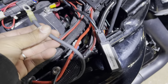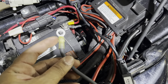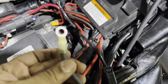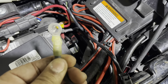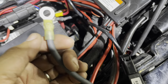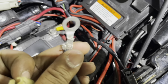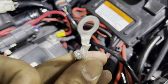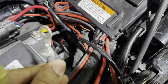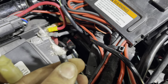This is an eight-gauge oxygen-free copper wire. Anybody that does 12-volt work knows that if the ring terminal is yellow, these are color-coded by size — yellow goes by sizes. And if you read on the wire, it says 12-gauge. How did they squeeze an eight-gauge wire onto a 12-gauge terminal? If you cut the plastic off and look, they did it by only putting half the wire in there. What's the sense of using eight-gauge wire if you're only going to put 12-gauge worth of wire in the terminal?